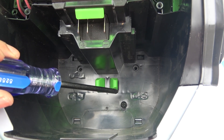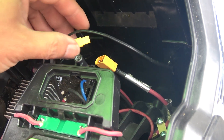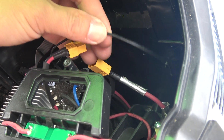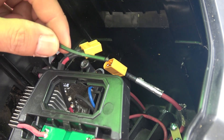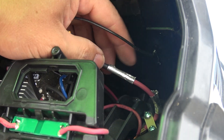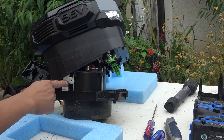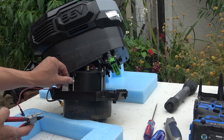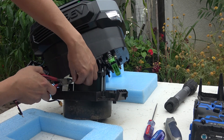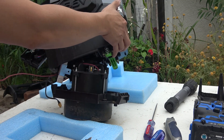There's actually a fifth screw that holds the bottom together, and that is this screw that we have to remove. Next step is to disconnect the cable to the motor using this connector. On this wire it also has a heat sensor wire that you just have to pull out — it's taped together to the red connector and you just pull it out. There's also a large ceramic resistor on the side that we have to cut the zip tie on, because it's only secured by the zip tie. Now we can just pull it out, just like that.